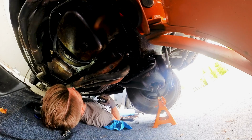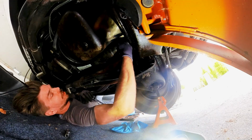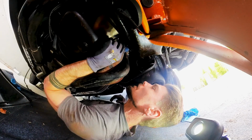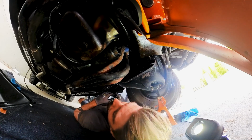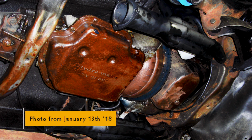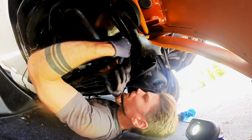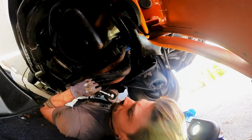Let's do the thing I came here for. The next thing to get started off is disconnecting the wires up front here. Can I reach those bolts here easily? Nope, cannot reach it. So maybe if I open these two and lower the starter a bit. I honestly can't remember how I got this thing in here when I installed my headers. But back then I had at least a lift to put the car on. And the lift does make things way easier. Yeah. Let's try to lower this thing real quick.